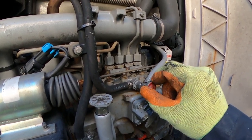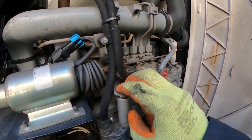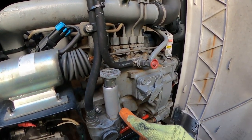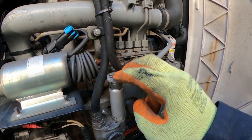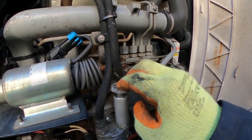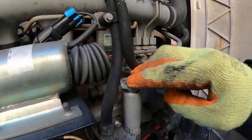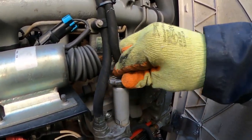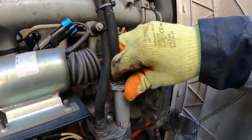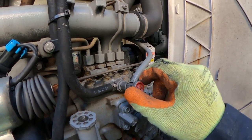This thing is very important — you have to twist it counter-clockwise, like this, and then just keep pressing for a very long time until fuel gets from the tank to the pump manually. Just press on this pump many times. Once you're done, press it back down and screw it back on.